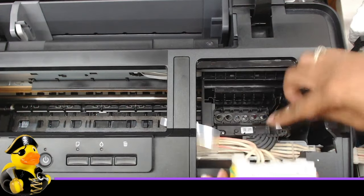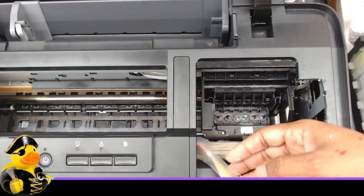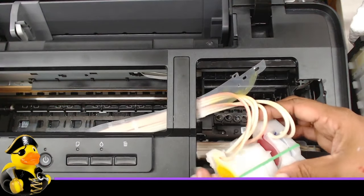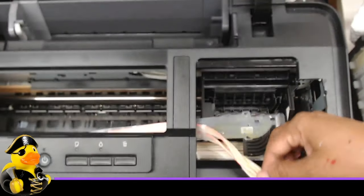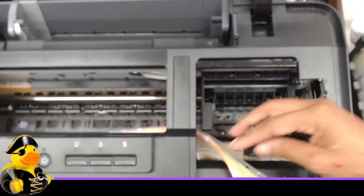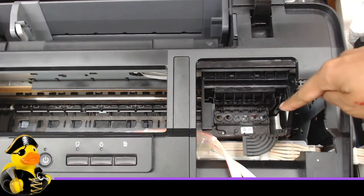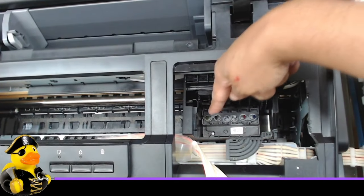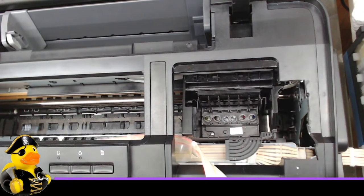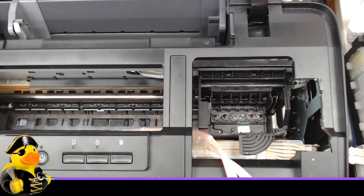I have all of the cords out of the track and hang them here. Be careful — each connection is just held by pressure and could come apart. Down in this section, one through six are the nozzles that suck ink from your cartridges and deliver it to the print head. This is our print head down here, and we want to take it out. It's held in with three Phillips head screws, but this bracket is in the way.